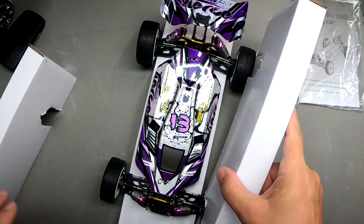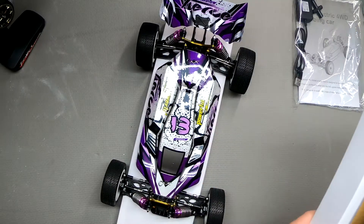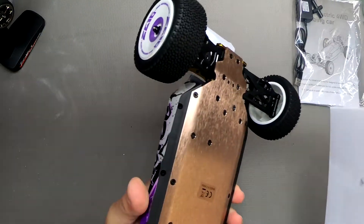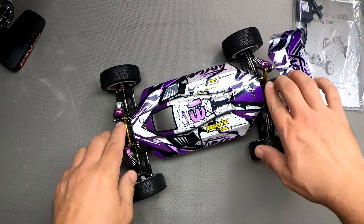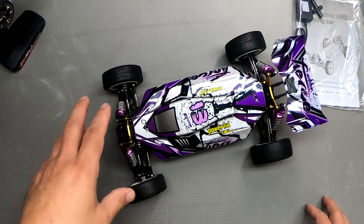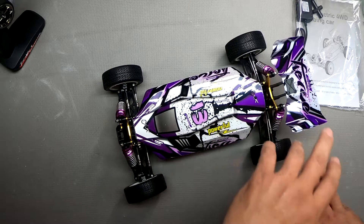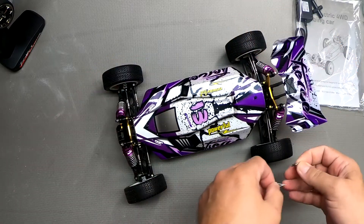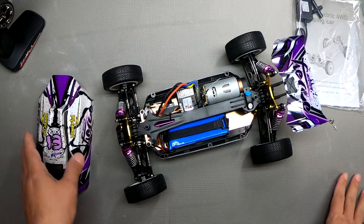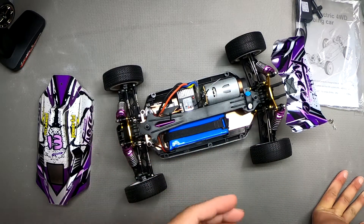These are just empty cardboard in the box — it comes fully assembled and is nicely packaged. There's our vehicle. A lot of times shock absorbers on pre-made cars either don't have any oil or don't have enough, so doing a rebuild on the shocks is pretty much a must-do. Another thing is that the differentials aren't always properly lubricated — sometimes they're just filled with a little bit of grease, and if it's a sealed diff you really want to do better than that.